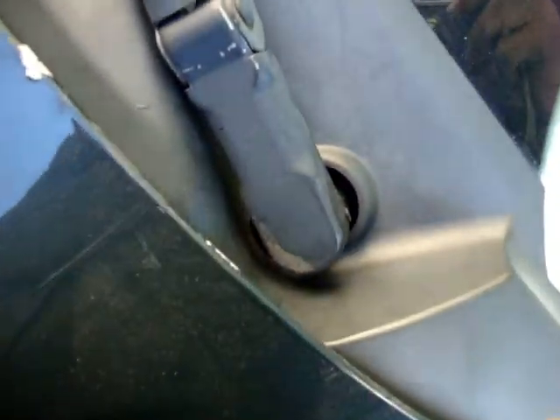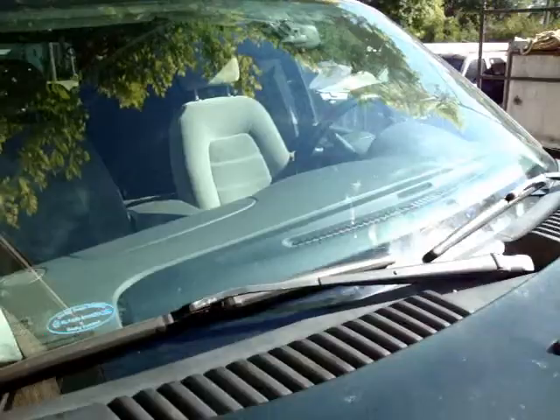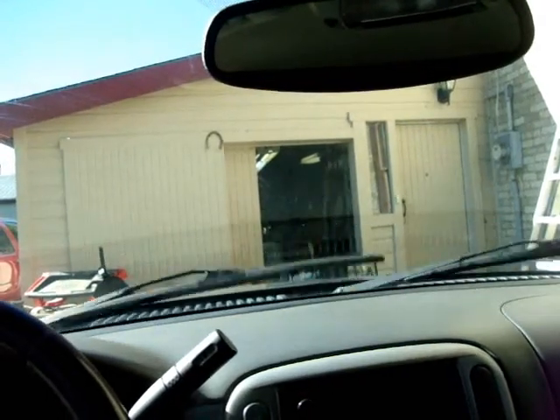Apparently something has been bent on these wipers because that doesn't look right, unless I got the wipers on the wrong side — but that's the way I took them off. We're going to check something out, make sure everything is straight. All I had to do is rotate the wipers a little bit. There are little notches — teeth in here — and you just keep adjusting it until you get the wiper set properly. There we go. Let me give that a shot. Oh yeah, much better — not jumping around anymore. Perfect.